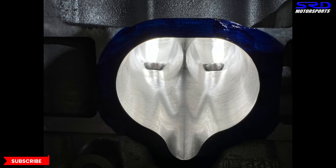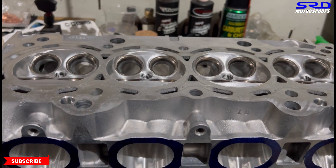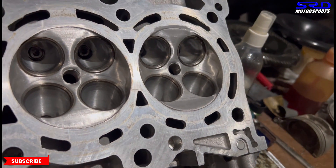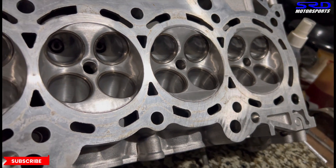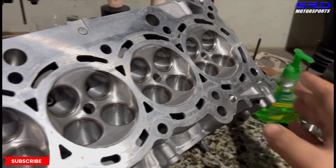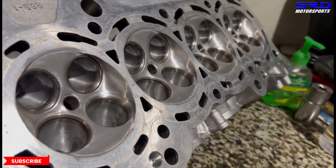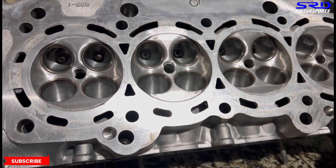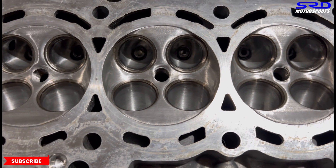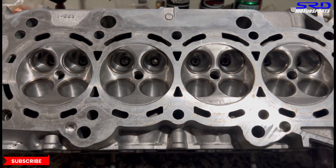Tilting the head upside down, you can see the chambers are looking really good. The intake ports are on the lower part — it's rounded off, no ridges, softened up. All the sharp edges or lines that could be hot spots are gone, it's all smooth. After the valve job, there may be a slight ridge again, and we'll clean that up. Finally, we'll check the CC of the chamber on each one.